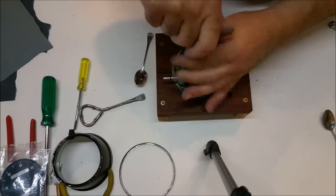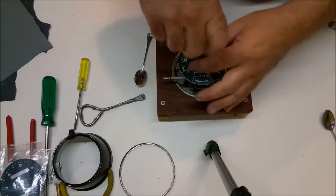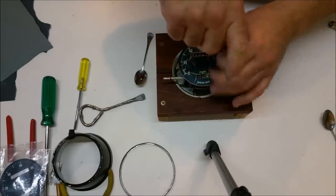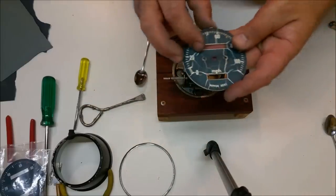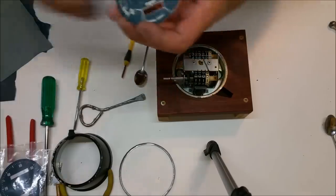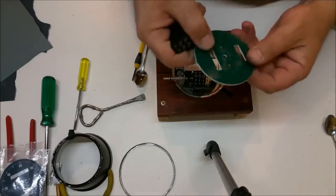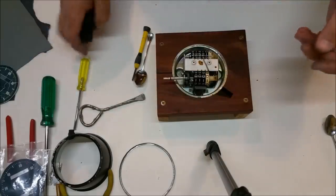Now they're only held in by two Phillips heads - they might be Japanese industrial standard, but Phillips heads move them off. We'll stick them in the inner housing where the lens is to keep them safe. And it comes off - it's a fiberglass-backed one. What we need to do with this is get rid of all that crazed material. These are kind of backlit - now if you put another overlay over the top of them, all that muck is going to show up. So I want to get rid of all of it so we're left with the bare fiberglass. I start with some 400 and finish off with 2000.